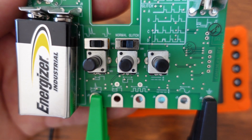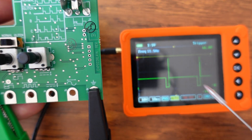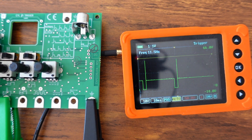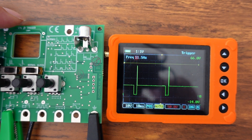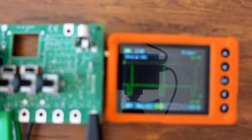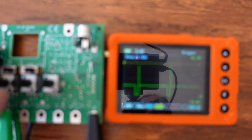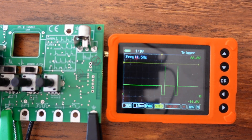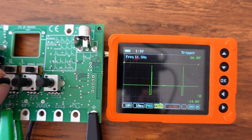We're going to walk through all these connections and also look at some simple U-Scope operations: how to adjust time base, how to adjust voltage, and how to move things around. First up, you can see the injector pulse width on screen — if you turn this potentiometer it increases the width of the pulse.